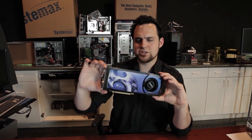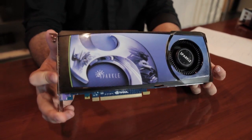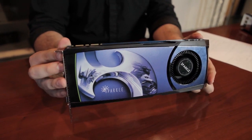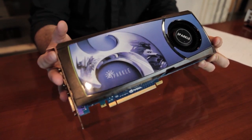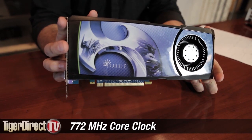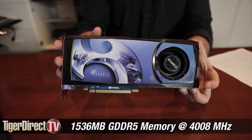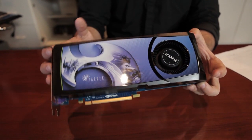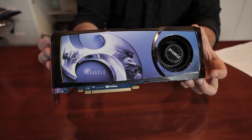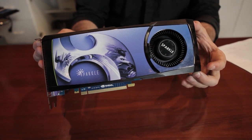Let's talk about what this card is specifically. You guys know what a GTX 580 is — it's been out for a while, but I want to cover it anyway. Let's go through the specs. This GTX 580 uses the GF110 core, 40 nanometer technology. It has 512 processor cores, or CUDA cores, and the processor clock is at 1544. The overall core clock is at 772 megahertz. It also has 1.536 gigabytes of GDDR5, and the memory clock is at 4008. It's a 384-bit card with very large bandwidth, PCI Express 2.0, and memory bandwidth of 192 gigabytes per second.